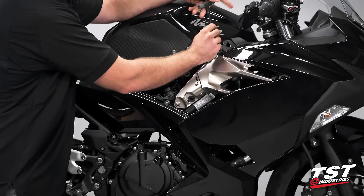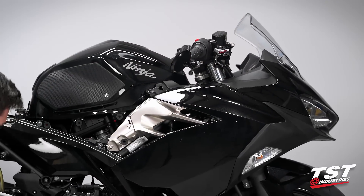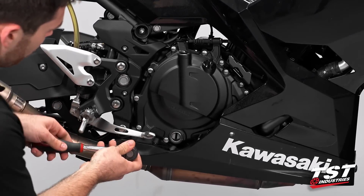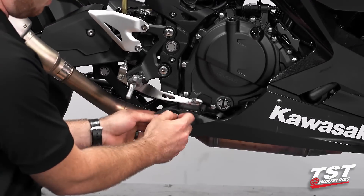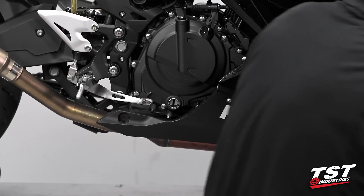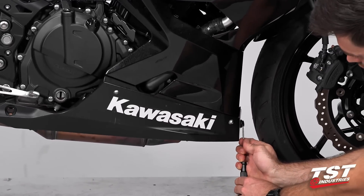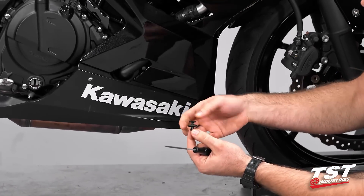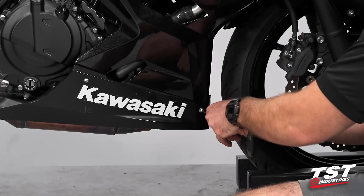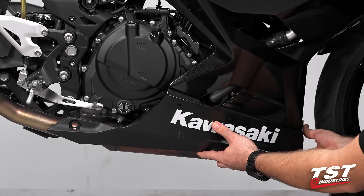There's a small tab here that's going to go into the front fairing stay area, and that's what keeps this in place once you have those two fasteners. With this off, we can set it to the side. Going to continue working with our M4 — remove this screw here and one right up here. Now we're going to move down to this lower fairing. With our M5, go ahead and break this fastener loose — it has a little shoulder on it, keep that together. Move forward to the front of this bottom fairing piece.